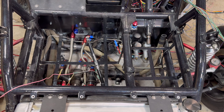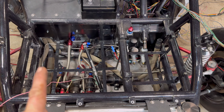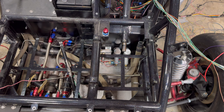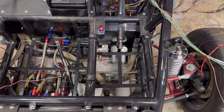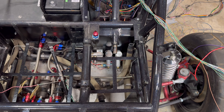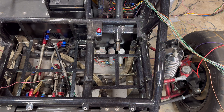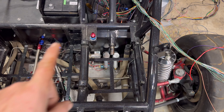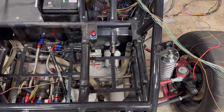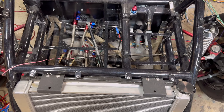I have to remake this brake line up front — the flare fitting cracked the last time I put it in, so I haven't been able to actually bleed the brakes. One of my biggest pet peeves is the master cylinders down at the bottom; they are almost impossible to get fluid into. I've been using a transmission fill pump to fill brake fluid and clutch fluid. I'm going to make a box that sits up here with two fill ports and run lines down to the master cylinders so I can just fill from the top.